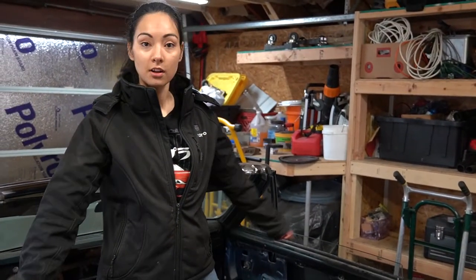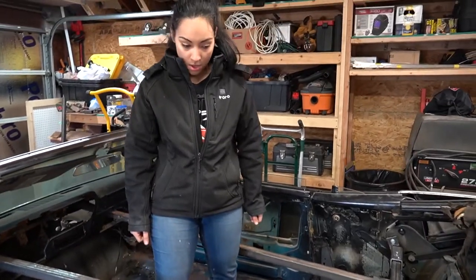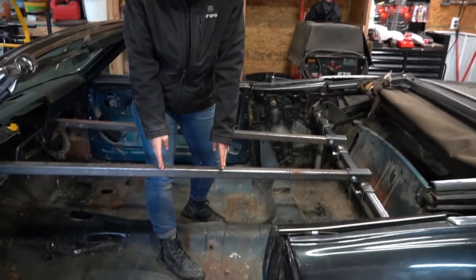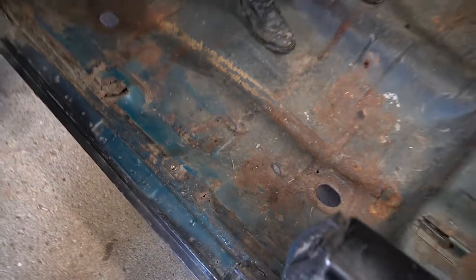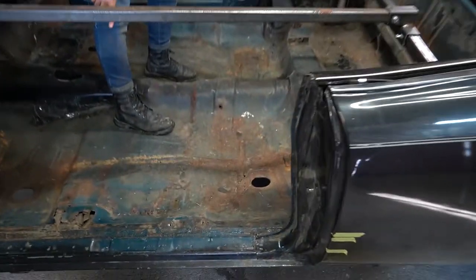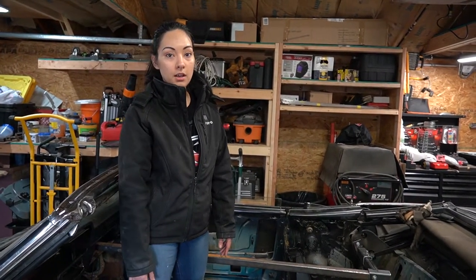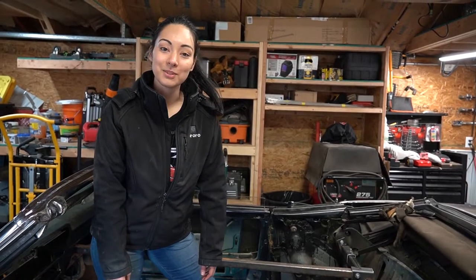Now that we've installed our pins and secured it, it feels really sturdy — we did a really good job on this. The only thing we do need to do moving forward is add another piece of tubing to locate to the seat belt holes, just so we can locate it later on. You can see there's a lot of rust on the floor pan and we'll very likely have to remove a large section of it, so in the event that we do have to cut it out, we'll have our point of reference moving forward. So with that being said, I think that wraps it up for this video. We'll see you guys in the next one — thanks for watching. Bye.